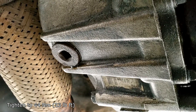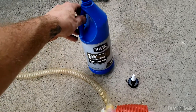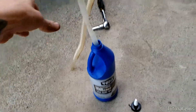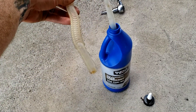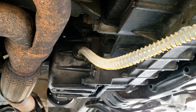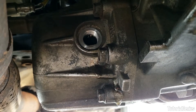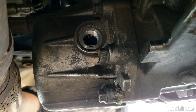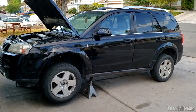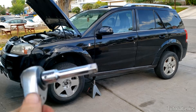Now that it's fully drained, replace the drain plug and begin refilling. You'll need a fluid pump to get the new gear oil in — the exhaust is in the way so there's not enough room without it. Just insert the pump, squeeze the bulb, and fill it up. You can't really overfill it — the oil will simply start coming out the refill hole when it's full, which is your signal to stop. That's 450 milliliters. Once full, you can also dip a finger to confirm the level, then snug up the refill plug and you're done. If the video helped, please click like and subscribe.